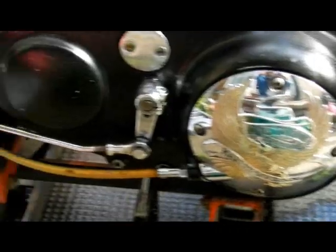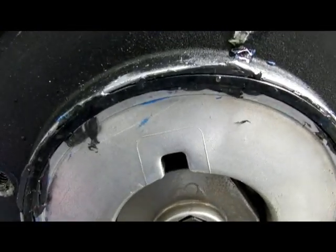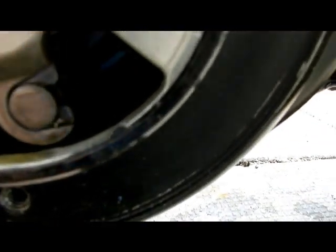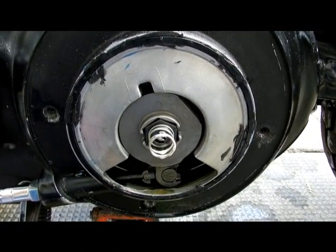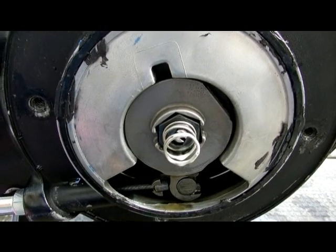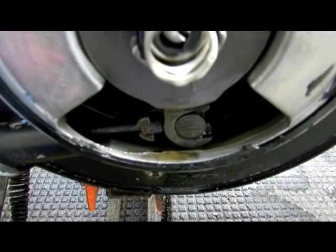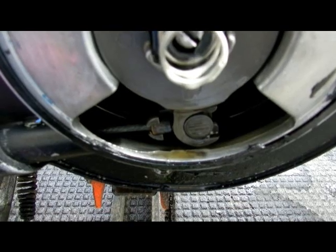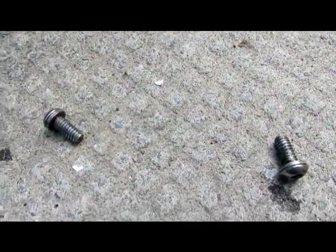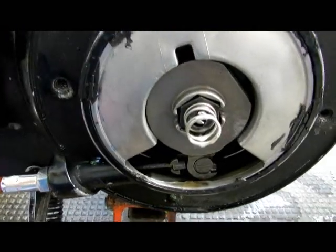Maybe this week I'll go buy a new cable. There's some kind of black crap smeared everywhere and you can tell it's an old gasket right here — the gasket's in a real bad shape. Look at this. We got the new one right there, got some chapstick to help it stick. There's a little too much fluid in there, it's way past the plate — it's been dripping out. One problem is too much fluid, another is the gasket, and a third problem is no anti-seize, no Loctite, no grease, nothing on the bolts.